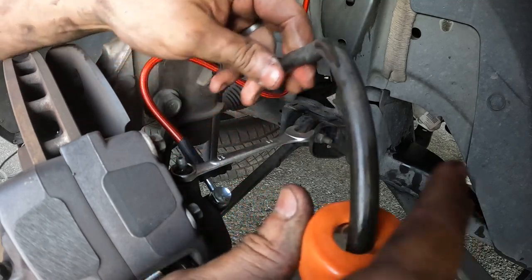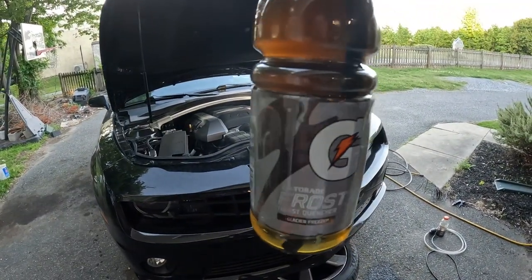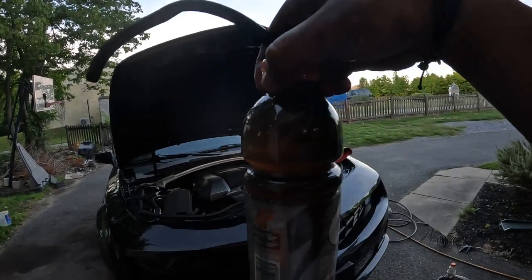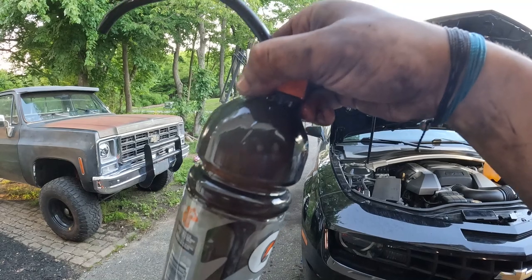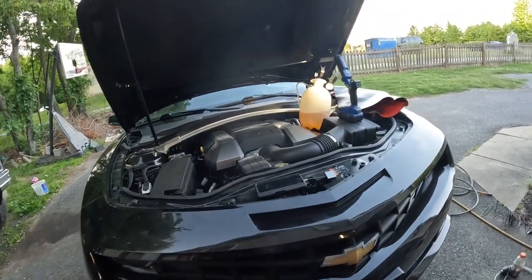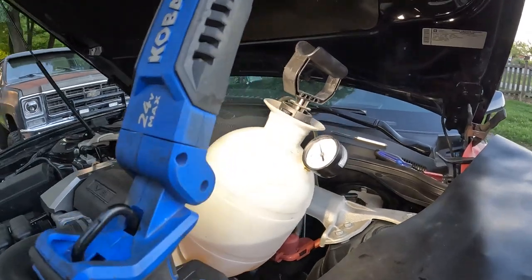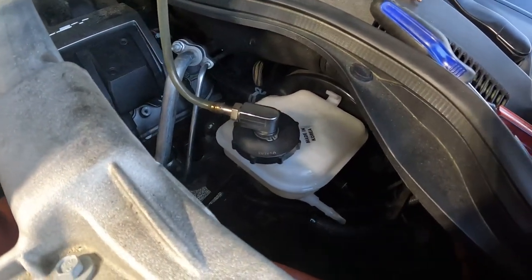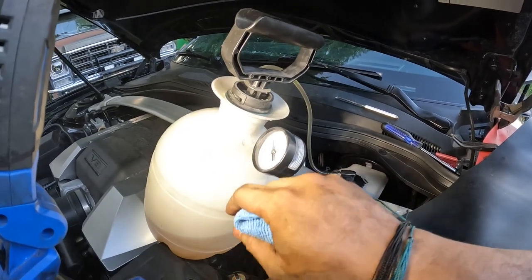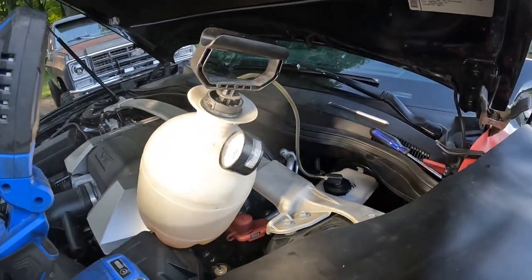Now follow the regular process — go farthest out and work your way in through all four corners. Look at what came out of there — pretty nasty. The fluid started looking really good towards the end, but it's awful — you don't want that in your brake system. I pumped it up to 20 PSI and went through it a couple more times. When you take the bleeder off you might have a little mess — no big deal. Make sure the fluid level is set to the right amount, and to release pressure on garden sprayers without a blow-off valve, just crack this slowly so you don't shoot fluid everywhere.